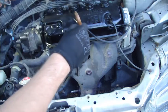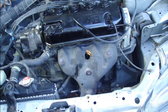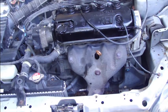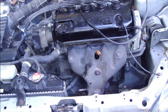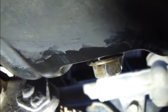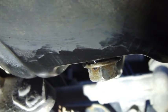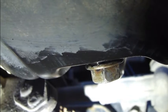Okay, and then we can install this stick, and we have only one check left. We need to start this motor and check that there are no oil leaks, and we do that next. Okay, now the motor is running, and we can check the area below for any oil leaks. Okay, now we are just below the oil bolt, and when we check the oil drain bolt status, there are no leaks, and we are very happy that this oil change has gone okay. And thank you for watching this video.